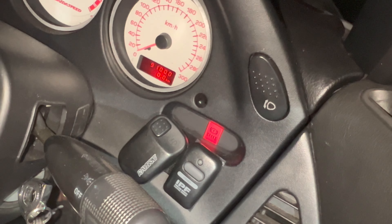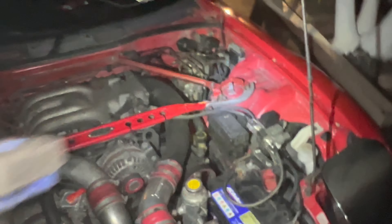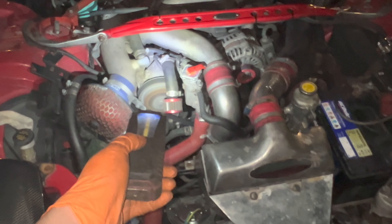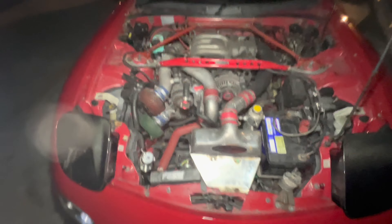Since I'm close to 91,000 kilometers I have to do my maintenance — oil change, coolant drain and fill from the block and the radiator. I'm going to do a fuel filter later because I have to relocate it, and then relocate the battery, and delete the air pump. I got the kit for all of that. Once I'm ready I will single turbo swap it and tune it at H3 Logic, because that's the closest to me and he's really good.